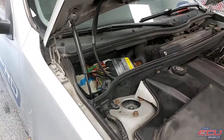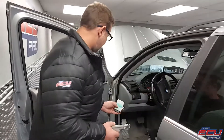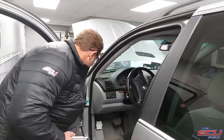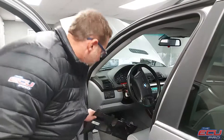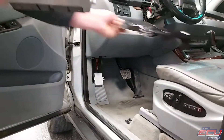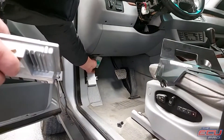Now I'll show you how to remove the EWS. The EWS will look like this — it sits under the steering column, right in that area. There's one 10 millimeter bolt to remove and it will slide off. To get to it, you'll need to remove this panel — it's three screws, very simple. Take it down and the EWS will be sitting there. This is it in this car, but it sits up tucked under there with a bolt.